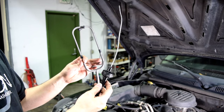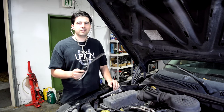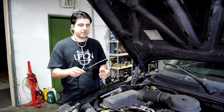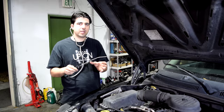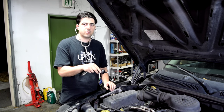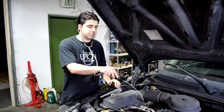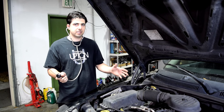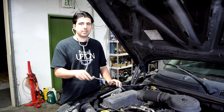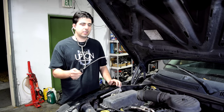For around 10 bucks you can get a pair of mechanic's stethoscopes at your local auto parts store, and these work fantastic. They come with a probe — I've managed to bend it out of shape trying to get into difficult to reach areas on the engine. One could also say they work a little too well for a beginner, because when you put this on the engine you're going to hear more than one noise, and it's going to require a trained ear. But if you practice with it a little bit, maybe try it on a car that's making a noise and then on another car that's not, you should be able to use this pretty efficiently.